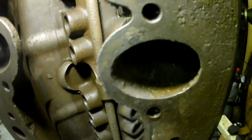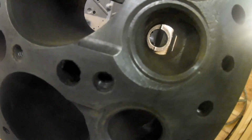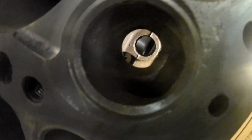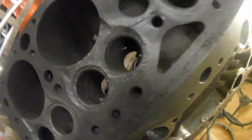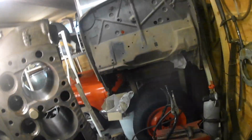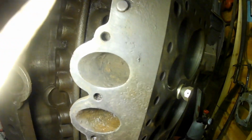Might try and get a brush. I was able to put a brush up the valve guides on this side, the valve guide holes. That was okay, I think. What I want to do is start boring. I'll just clean the ports on this side, get the worst out of these ports, the valve bowls and the inlet ports. Can you see how rough the casting is?